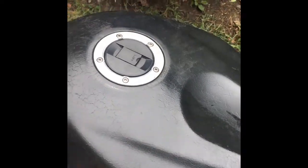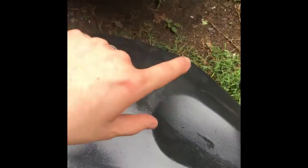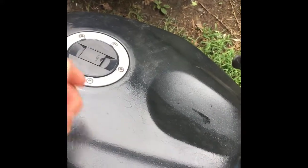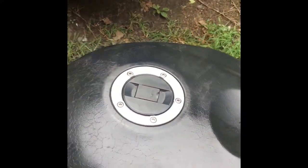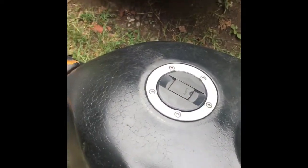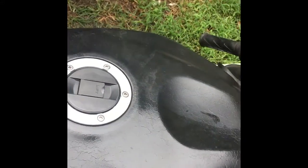It was just that little piece down inside the fuel tank that had fallen off. I just put it back on, and to keep it from blowing back off I put some zip ties around the fuel screen and that piece just to hold it on, pulled it real tight. Started right up yesterday and rode it around.